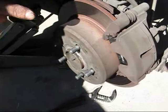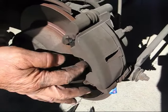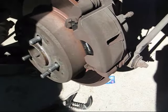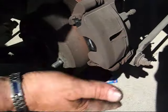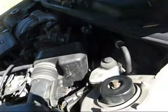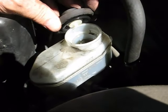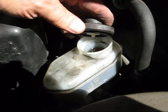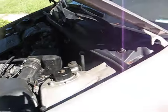Let's do a quick recap. All we have to do with these back brakes is take this one bolt off, flip this up, take out the two pads, squeeze the cylinder back in, put the two pads on, and put this back. This is even easier than the front. We check the master cylinder reservoir — the fluid hardly even came up, so it's up on the high level. We're in good shape, so we can close this off.